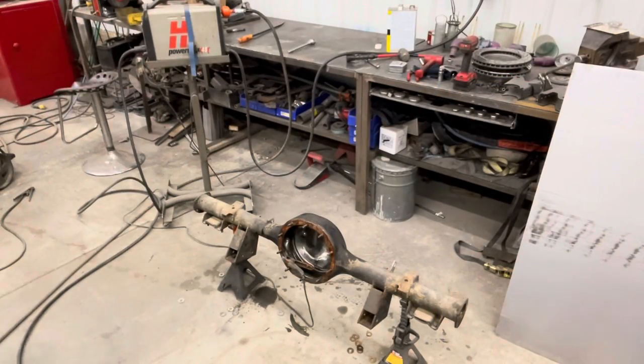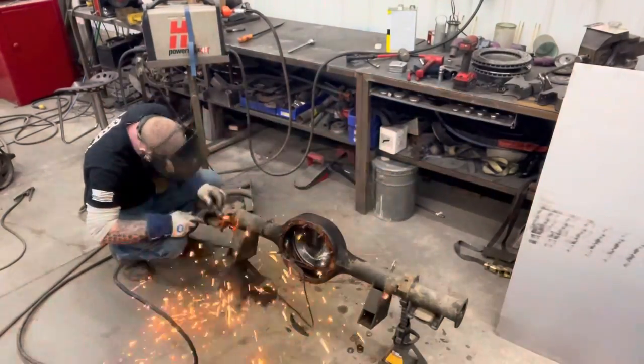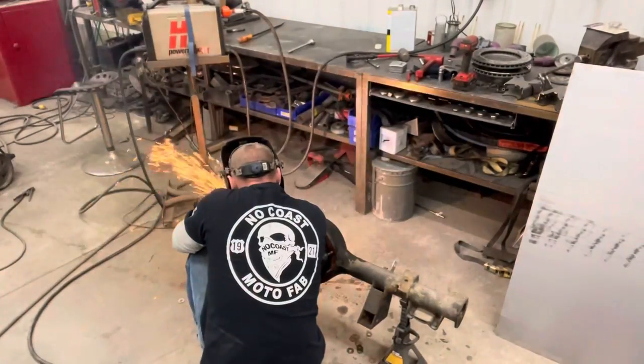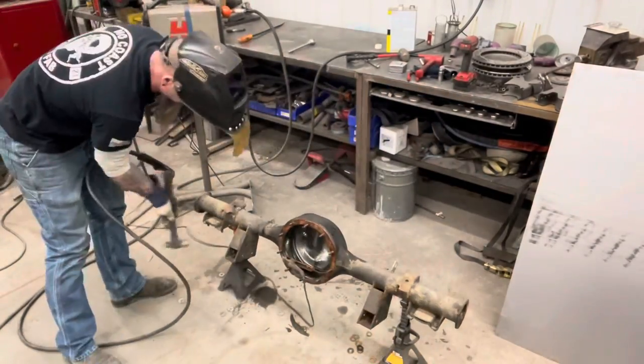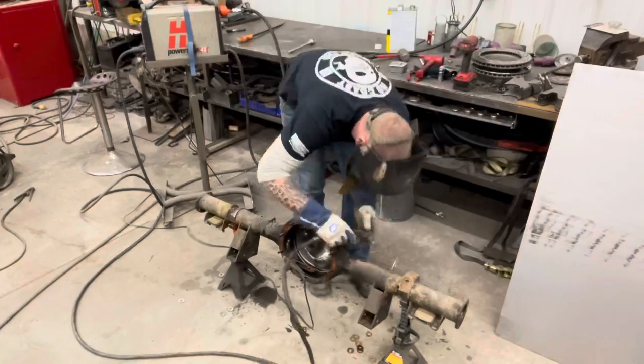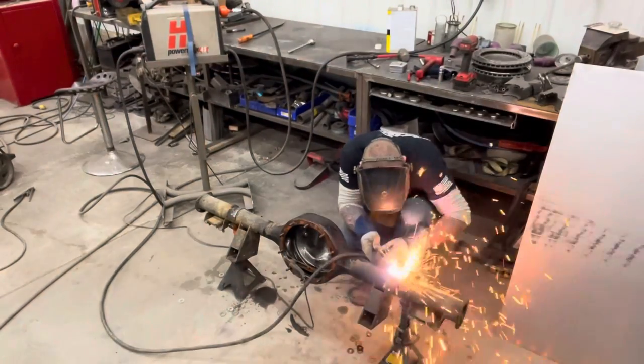All right, we got the plasma cutter all set up. We're gonna start knocking all these brackets off. Now you'll see, I'm gonna leave a little extra on every one of these. I'm not gonna take it down tight to the tube. That's where you normally mess up and you'll start gouging into stuff. Leave a little extra. The reason for getting all these out of the way is just to make it easier